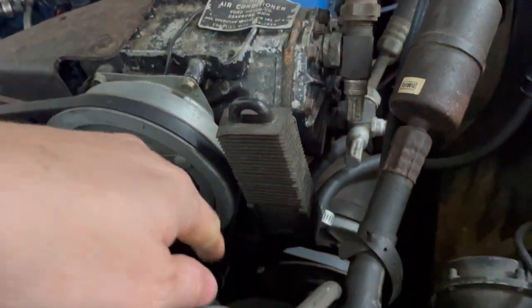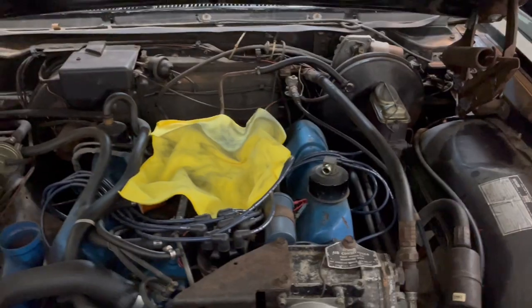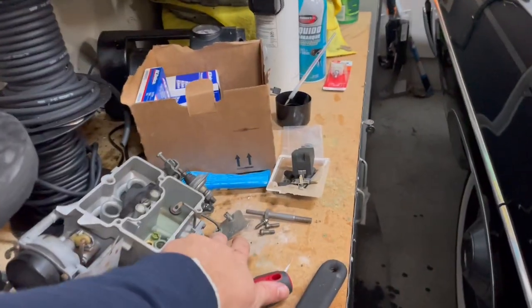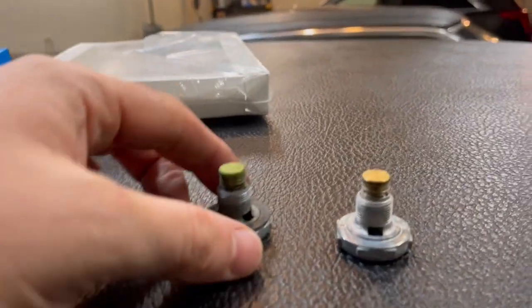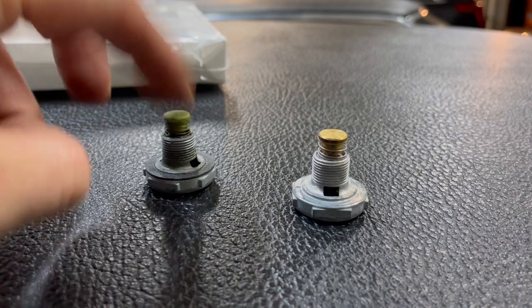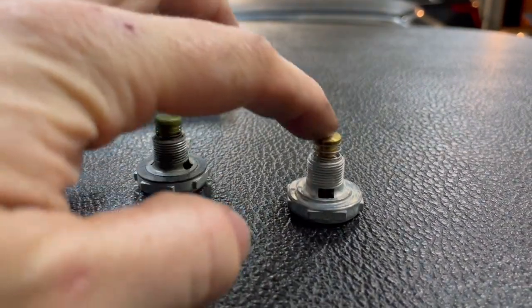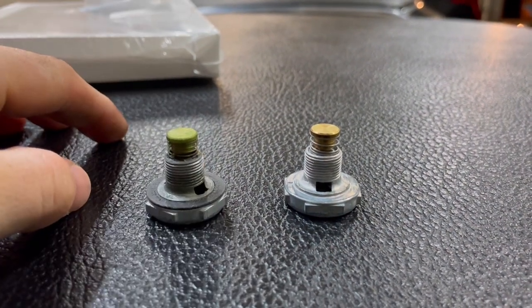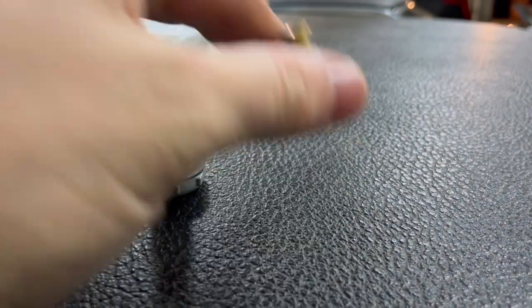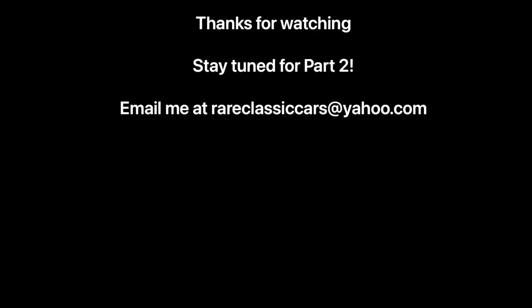From a visual inspection I could also see the fuel pump on this car is quite new. So somebody thought the fuel pump was going bad and that's why it was bogging on acceleration — it was misdiagnosed. The real issue is the stuck accelerator pump diaphragm causing the bog, and the stuck power valve not allowing the mixture to richen. It's not even moving. It always feels great when you have a hypothesis about a diagnosis and you pull it apart and you can see it's definitely bad — you know putting in the new part is going to make it run much better. I hope you enjoyed part one of rebuilding the Motorcraft Autolite 2100 carburetor — stay tuned for part two.